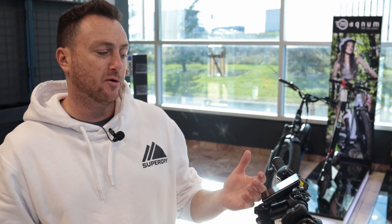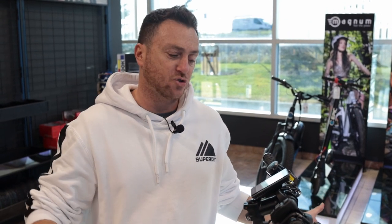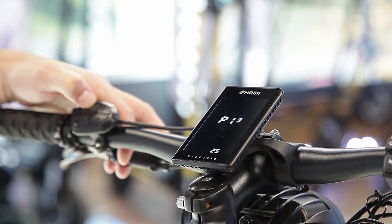P13 is battery protection mode. By default it's set to 25 — once the battery drops to 25%, the scooter automatically switches to E (economy) mode regardless of your current mode. You cannot change out of economy mode until the battery is recharged above 25%.